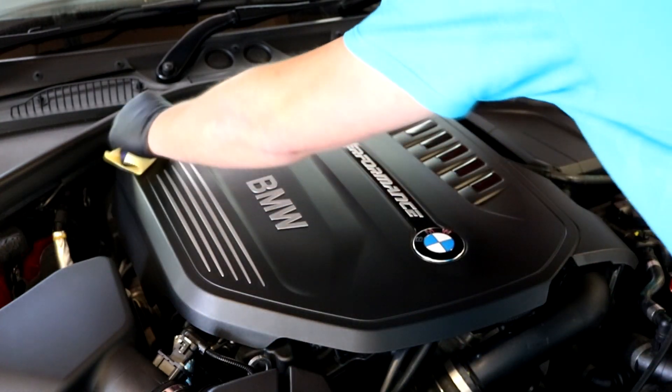The main aim of this video was to observe the ceramic coating on the plastic trim. I've never put a ceramic coating on plastic trim before. Whenever you see videos of people putting coatings on trim, it always looks so sexy and controlled. The first thing I'd say about laying this coating down is — and it's a very limited experience opinion — there isn't the same in-depth prep required as when putting it on paintwork. Putting ceramic coatings on paintwork is a considerable undertaking, but putting it on trim isn't — you've just got to get the stuff clean and degreased first.